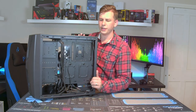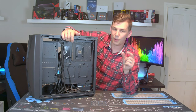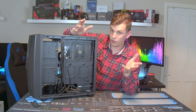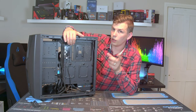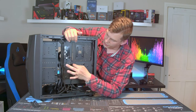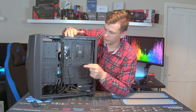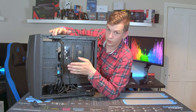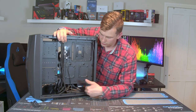The hub has pretty much all the fans it needs: a pair of 200mm fans at the front and a single 120mm non-RGB fan at the back. There's also a socket for the rear RGB fan, an LED out for LED strips, and a connector at the top for the included cables. They include two cables — one for a 3-pin connection and one that looks like a normal RGB connection but with one pin blocked — so whether you're using Gigabyte or Asus, most bases are covered. That cable plugs into your addressable 5-volt header on your motherboard. Do not plug it into the 12-volt RGB header or you will blow things up. If your motherboard doesn't have a 5-volt addressable RGB header, you can't use it.